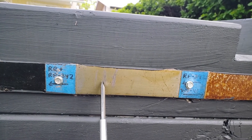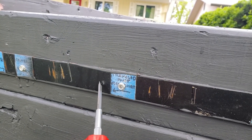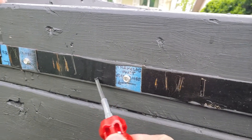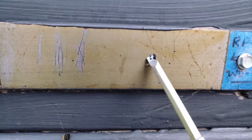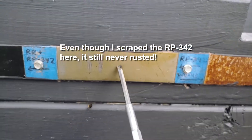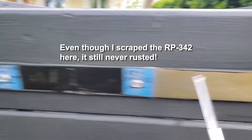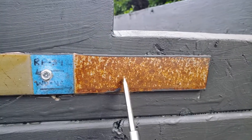Right over here is the most interesting part. The Cosmoline acts as a wax layer and is itself a rust preventative. But if you're painting a frame with spray paint and you put that over the frame, you have no protection against rocks. As you're driving, rocks hit the frame, you get little scratches, and eventually that leads to rust — a rusted out frame. The Cosmoline offers a layer of protection over just paint — protection against rocks, dirt, and especially salt from getting through your paint onto the frame. As you can see, no rust.